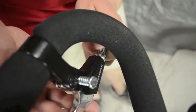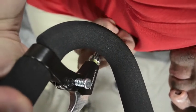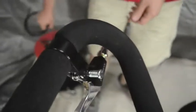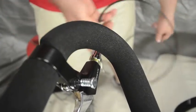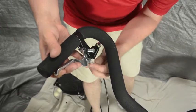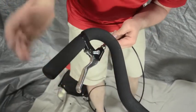What I'm going to do is take this ferrule and spin the outer one out, look underneath, and make sure that it's about two-thirds of the way out, then line up the slots so that I can fit the cable through. I'll take the brake cable, unwind it, take the end of it, pull back and insert it, make sure the cable feeds through, and then let the handle back out.